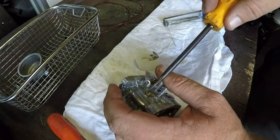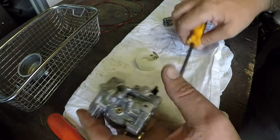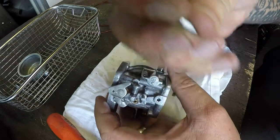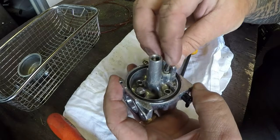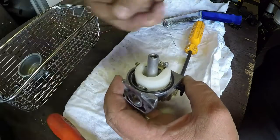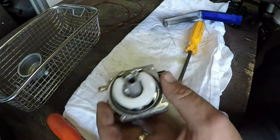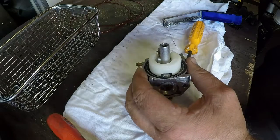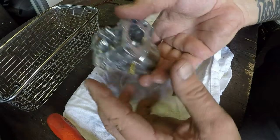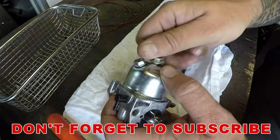So they have that little Mountfield 414, which is quite nice. That goes in. I'll make sure that needle, it's a little spring loaded needle, so make sure that's working, which it is. That goes in there and goes on there, and I want the little tiny pin. Little pin, and I want the bowl, which is spotless. That's going to go that way around. A little tiny 10mm at the front, so I can bleed it if need be.